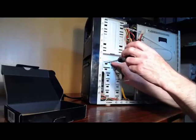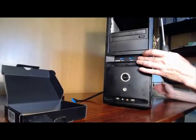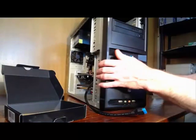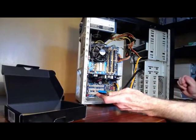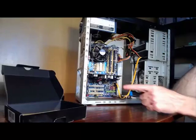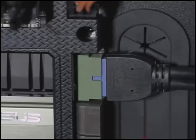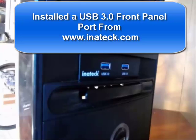Get it fairly flush at the front, then tighten the screw — that's it installed in the case. If you have the port on your systems board, plug the connector into it. It's keyed so it will only fit in one way. The connector on the motherboard is usually blue but can be another color — consult your manual to find which one it is. That's it — you have now installed a USB front panel. Thanks for watching.